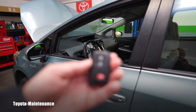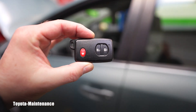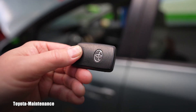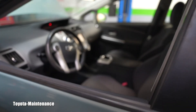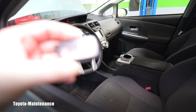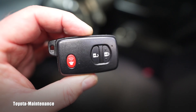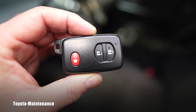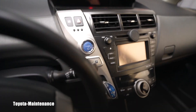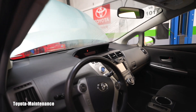So I grabbed the remote, sat in the vehicle, pushed the start button — nothing. This is a smart electronic key, so it can be anywhere in that area. It doesn't matter where you put it inside. When I stepped on the brake and pushed the start button, in the dash all the way to the right-hand side there was a 'no key' — an orange no-key symbol.